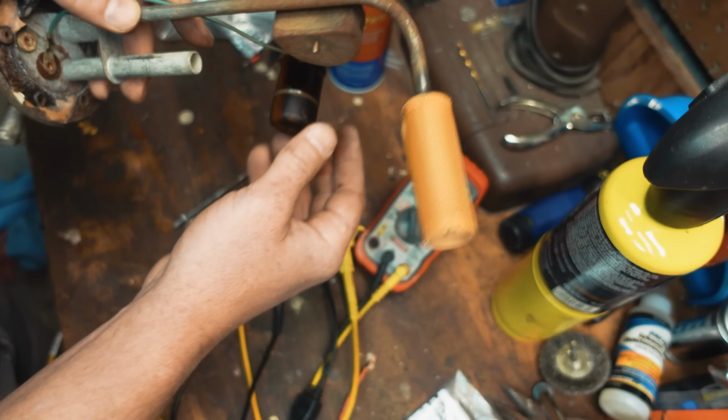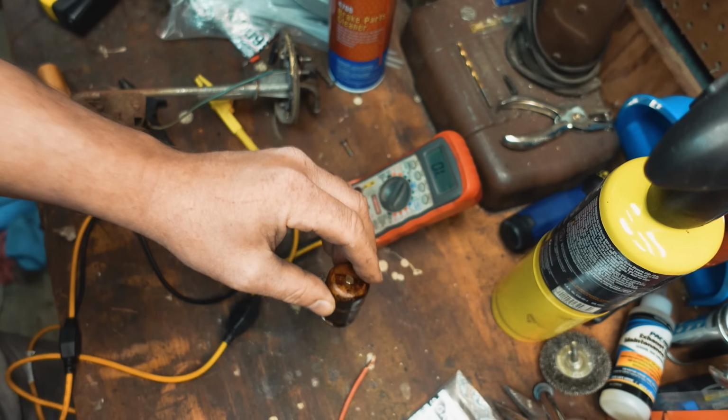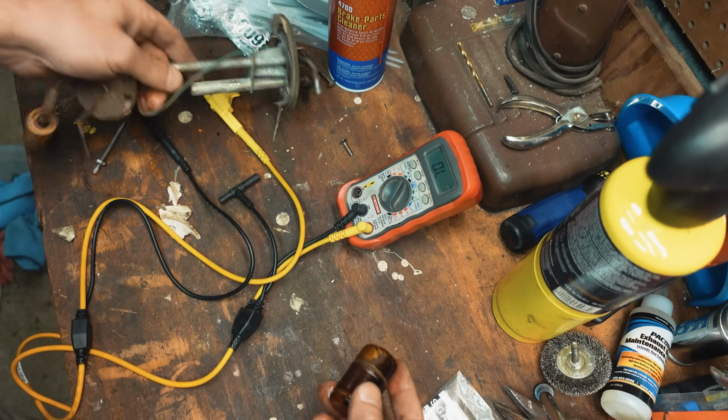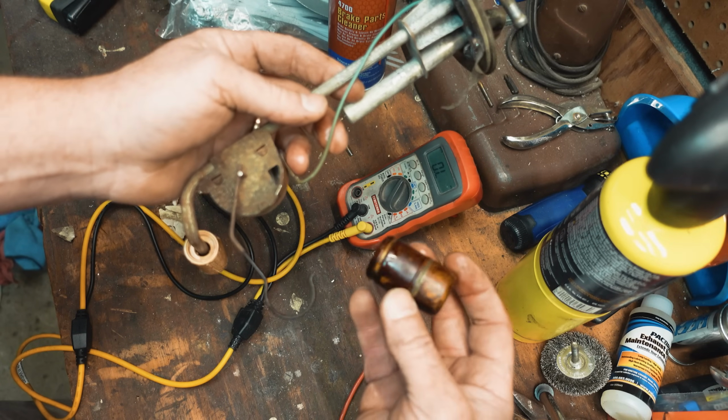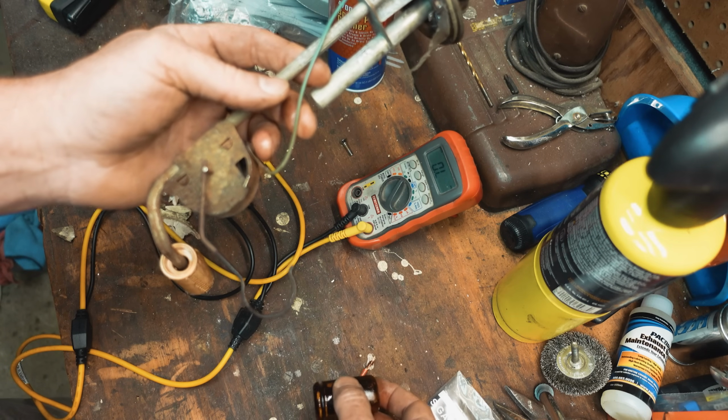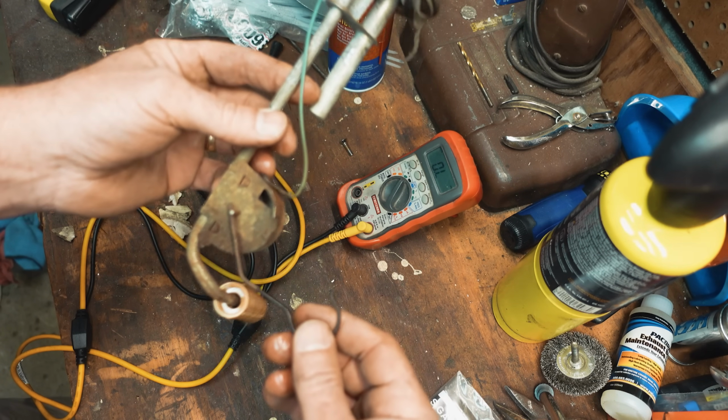Yes, and it's leaking. Full of gas. So even if you fix the float, the resistor inside, you still have a barrel that's full of fuel. And that's going to mess up the float. It'll never work right. I need to order a new one.